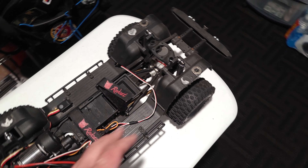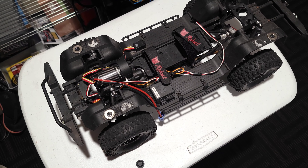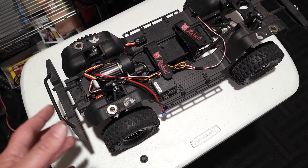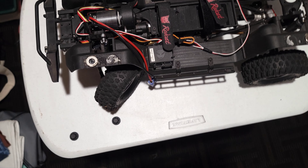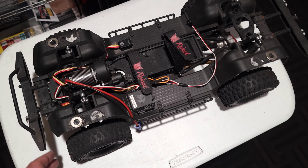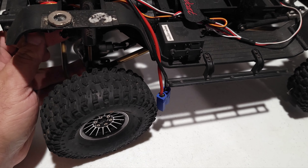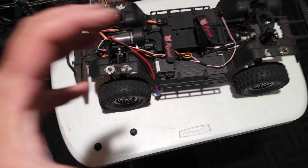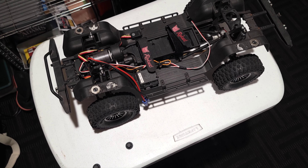It's mainly the links — you got some brass here. As far as the front axle, I'm kind of thinking of doing the Gen 9 front axle once I have any more issues out of this. For right now it's fine. I'm the kind of guy — if it ain't broke, we ain't going to fix it. But I was thinking about doing the Gen 9 front axle just for that turning radius. It has just an awesome turning radius. However, when I do turn it to this angle, it will bind a little bit. What it'll do is actually bind and try and wrap this front axle under itself and basically kind of load up that suspension. And when it does it on the rocks, the thing looks so funny because it just bunches up. So I got to kind of back off it and let the suspension relax again. That's really the only driving downfall I have on this thing — that steering angle.